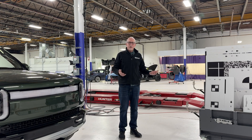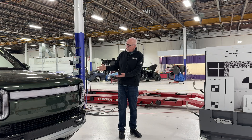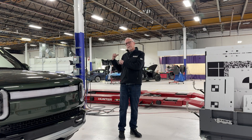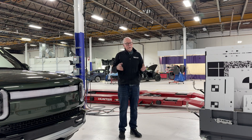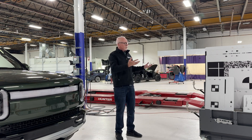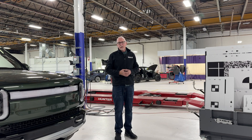We took a look at the equipment and processes needed to calibrate the ADAS system on this vehicle. This Rivian failed the thrust angle alignment, so we returned it to the alignment rack, performed an alignment, brought it back, set up the system again, and performed the calibration through the laptop with our dongle connection. Just this equipment alone is about a $150,000 to $170,000 investment — not everybody's going to have that, and certainly not the person who shows up in your driveway to replace your windshield.